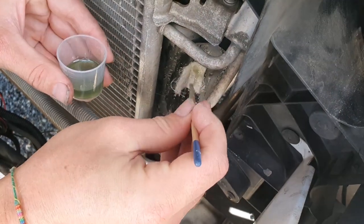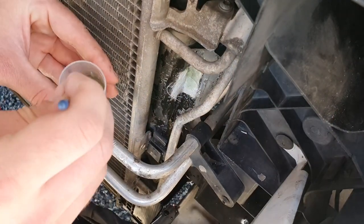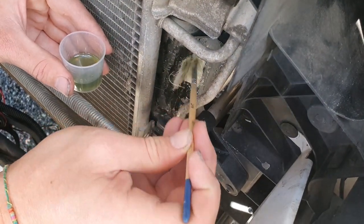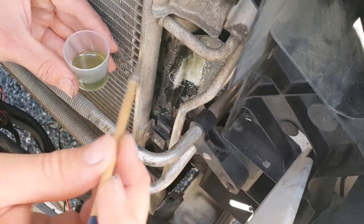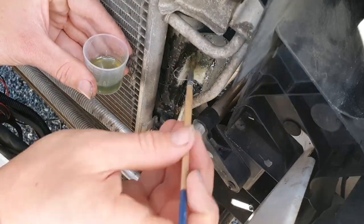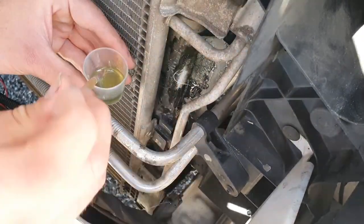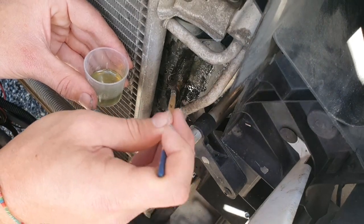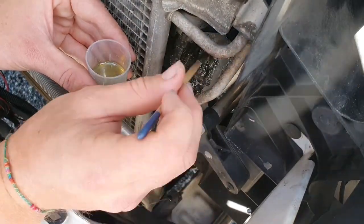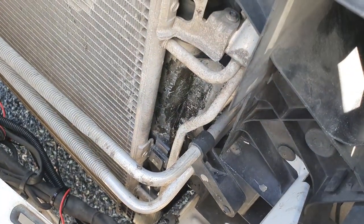And we'll actually wet it down nicely. Fiberglass has to be clear pretty much to make sure that you've got enough epoxy in it. And then we'll put one more layer on the top.